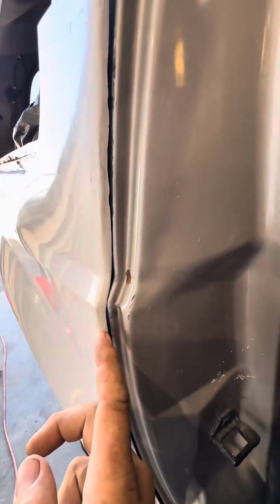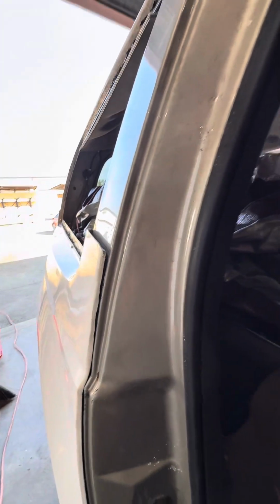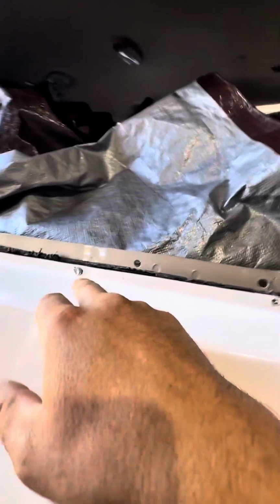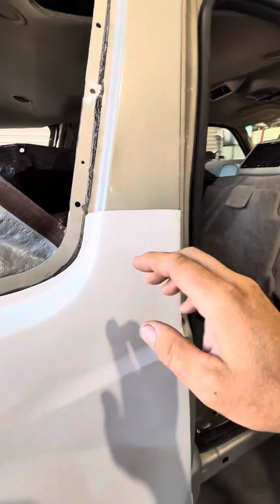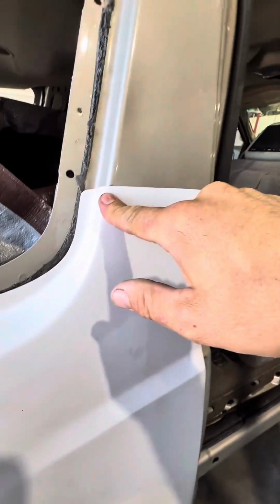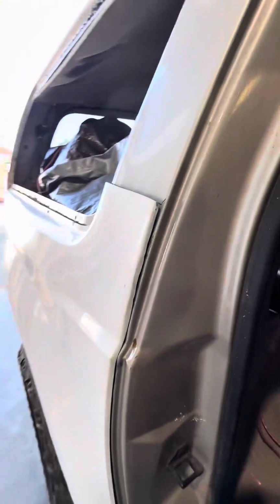So what I'm gonna do is finesse this some more, use a little Dremel bit looking thing, and then get it as flush as possible, and then the transition, the body guy is gonna fill it up behind it. It's gonna have to sit flush, but we use, what is it called, panel bond. We use panel bond, and then we have these self tappers here. This is for now just to line everything up, and then we'll use panel bond and push it in, and then put the self tappers back in to hold it nice and snug while it's drying. And then we'll take the self tappers out, and he'll fill it with fiberglass, and it'll be over with.